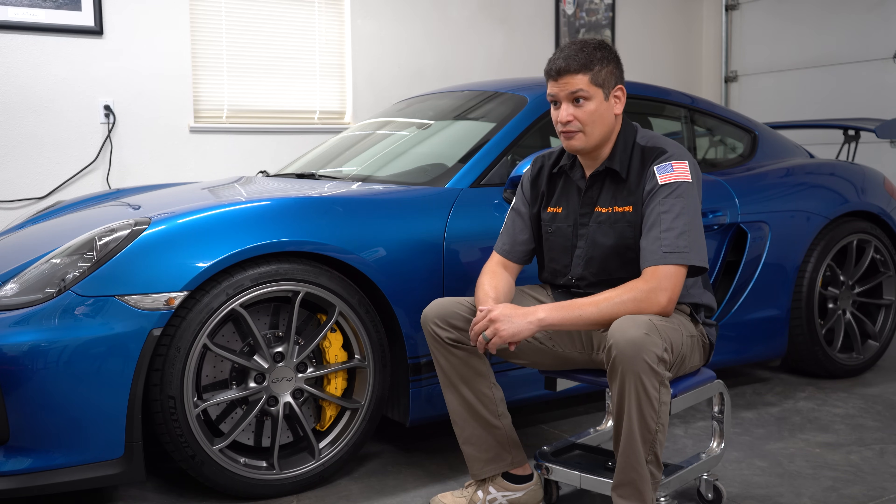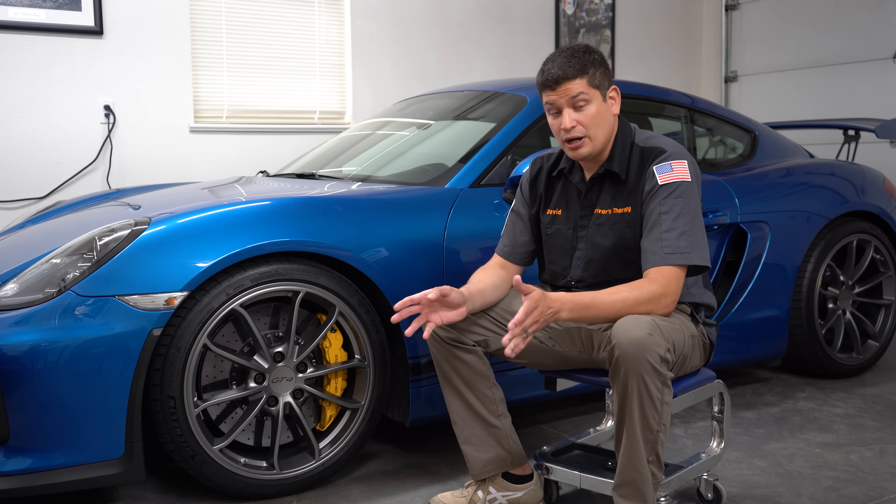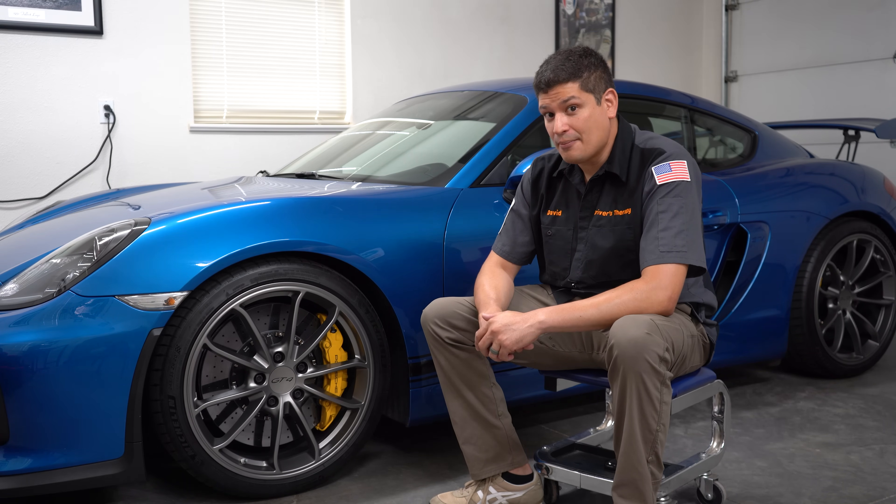Carbon ceramic brakes are completely different from your traditional brakes. On your car, unless you have nothing but performance cars, you're probably going to have steel brakes, which are great and do a great job. But steel brakes are heavy and have a shorter wear-and-tear life than carbon ceramic. They're metal-on-metal contact, prone to warpage, and in motorsports they're going to wear down more.